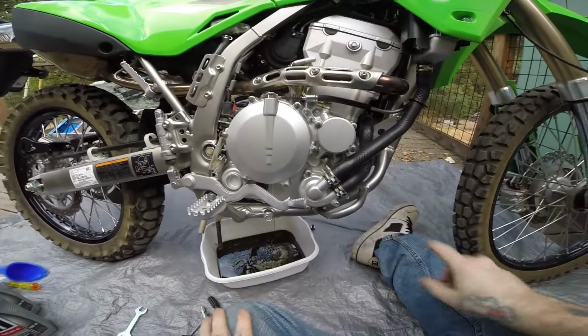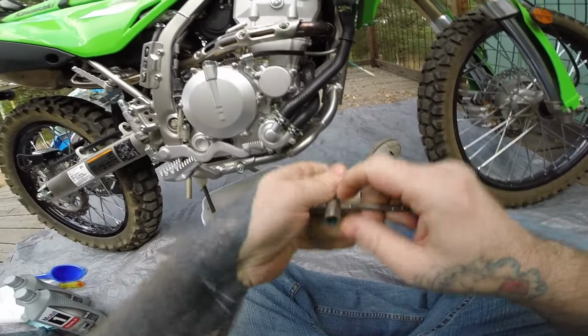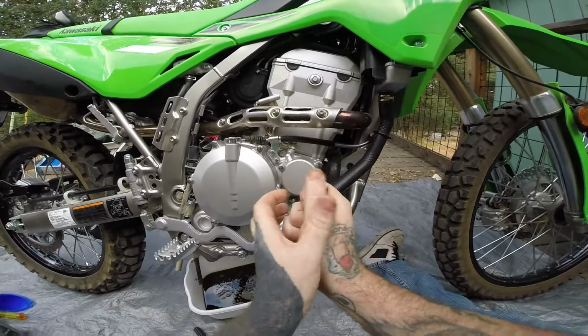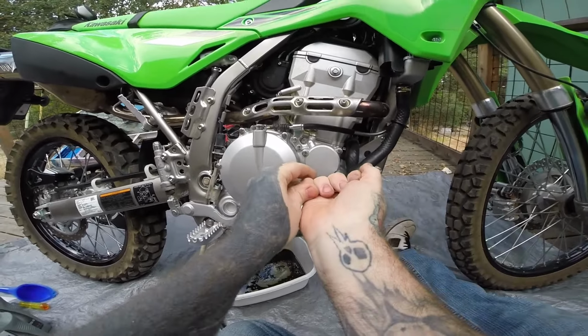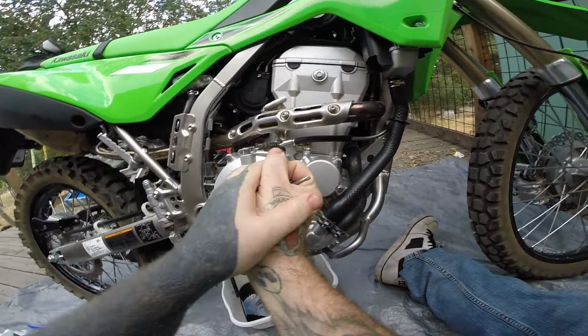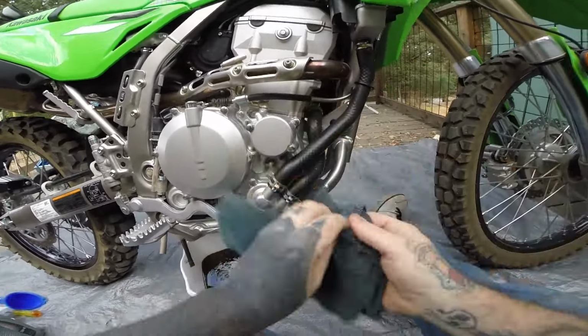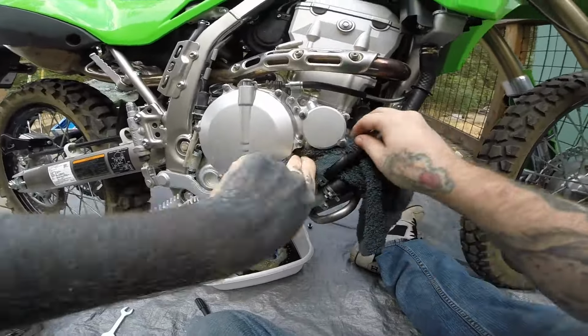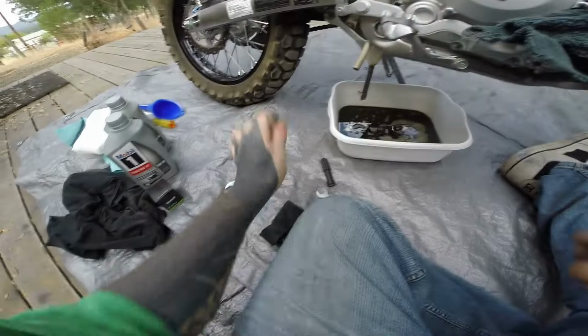On the other side now. All right, so you've got your oil filter right here. Yeah, let's do this. See, those are the 8s right here. So you take your screwdriver and insert it. It doesn't let you go all the way through, but it lets you get enough little torque on it to break those loose, and these are not very tight at all. Oh, we'll put some rags down real quick. Hopefully I can feel some of this help. Alright, now finish taking these off.